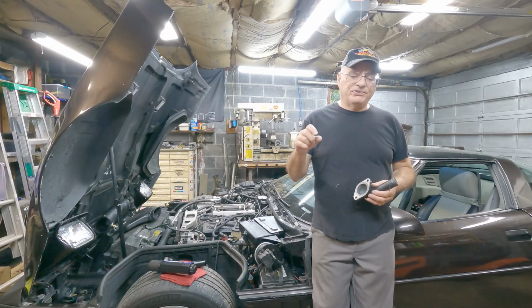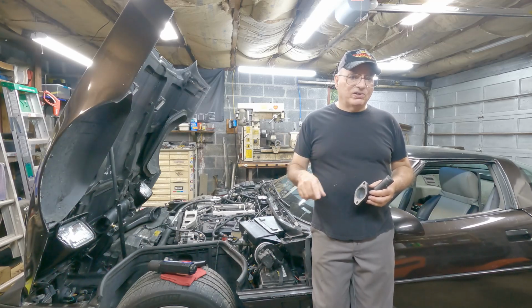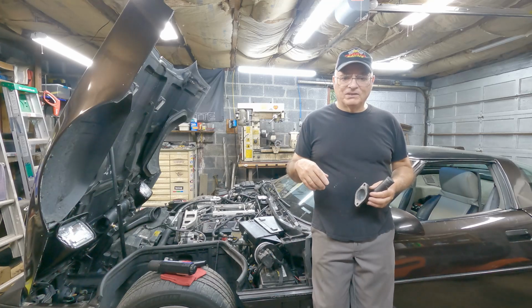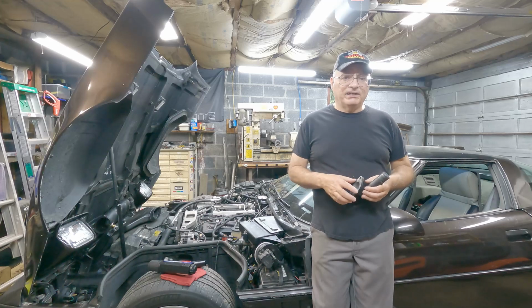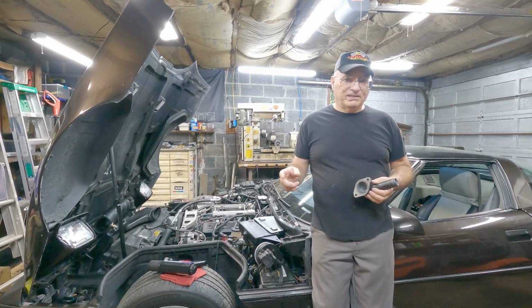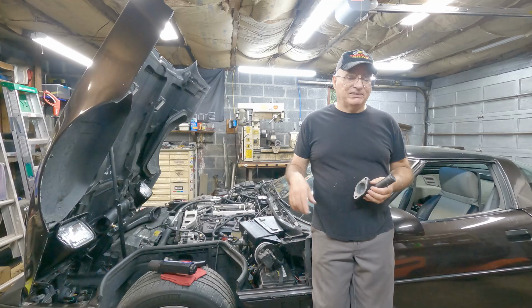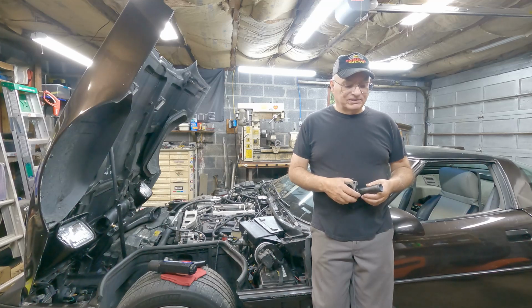I spent more time changing those little sand rolls on the sand drum attachment than I did sanding, because that metal gasket just eats those little drums up. I tried using a stone, but it took a real long time. I didn't have an aggressive enough stone. I could have used my air-powered die grinder that I use for porting, with a stone or a sand roll, but I just didn't feel like listening to that thing whir and run the hell out of the air compressor.